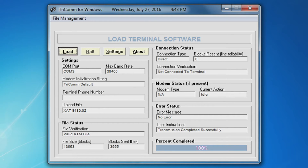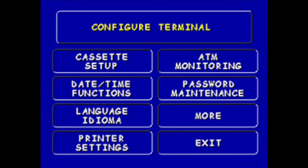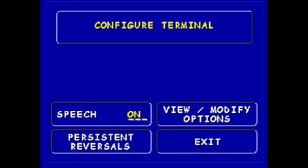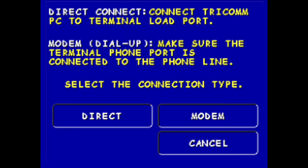Select save and load. Once your software load is complete, reboot your ATM. Once your ATM has rebooted, log on to your main menu. Select configure terminal. Select more. Select more again. View modify options. Plugin management. And select direct. Check that.